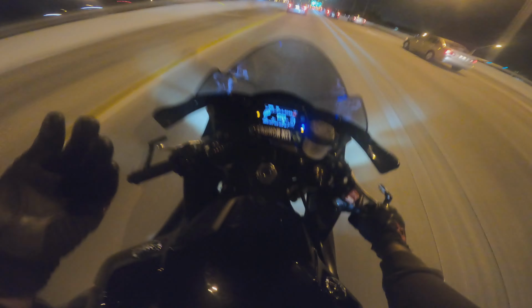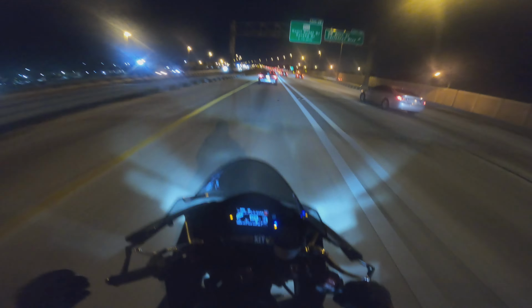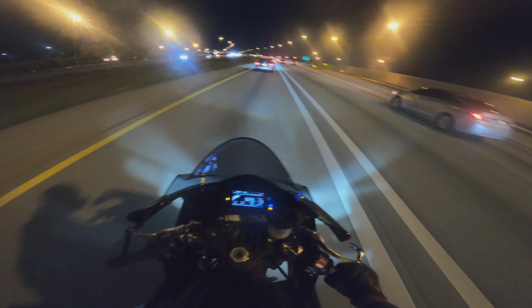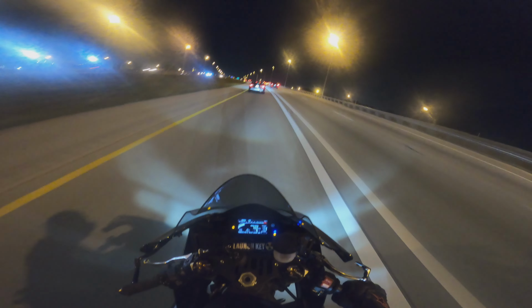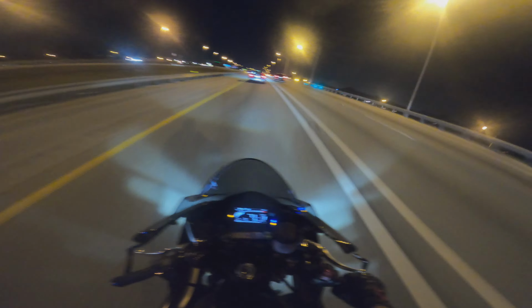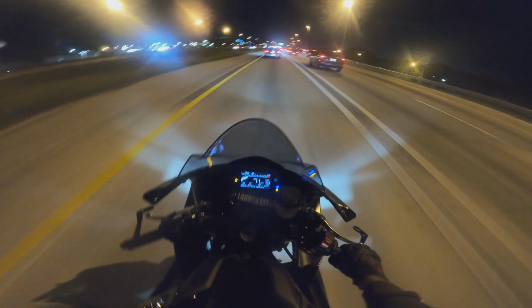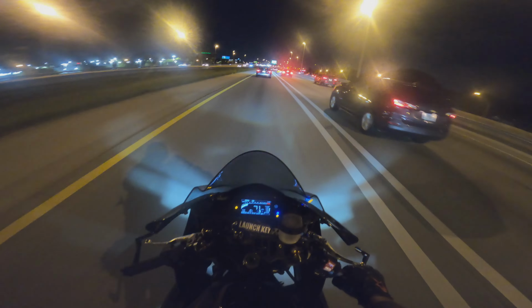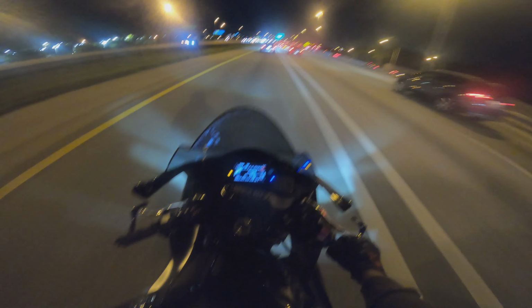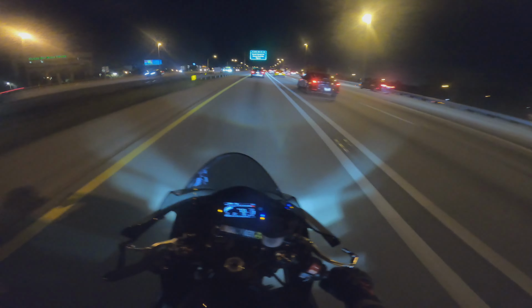Okay, so I ordered these hand guards, right? And they come with a little insert. So when you put it into the hand guard, the little hole, it expands. But the problem was, in that hole, there's something in it, the OEM insert. It's just a threaded metal piece with rubber all around it, like glue, and it's really hard to take off. So I had to drill into it and scrape off the glue with a knife. I didn't do it perfectly, but I got it to the point where these hand guards will fit good enough.